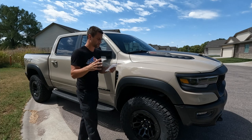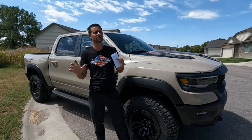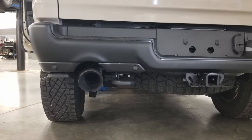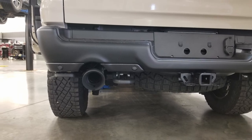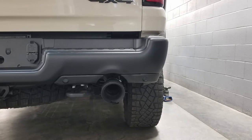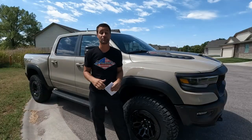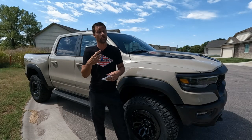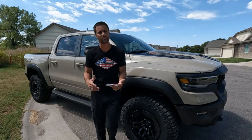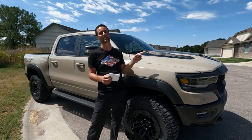So here's all the stuff I still found bad or incorrect on this brand new TRX as of today. First: the rear exhaust tips have been misadjusted since day one. This one wasn't that bad — they just hung down really low. Every single truck that's come in has had them either hanging down or crooked. I loosen the 13-millimeter bolt, adjust the tip, tighten it down. It takes no time, but come on — a little more quality control on a hundred-thousand-dollar truck.